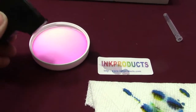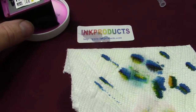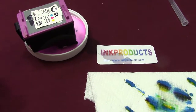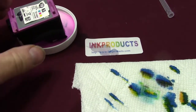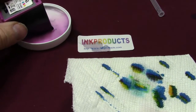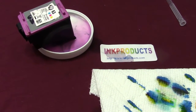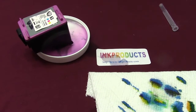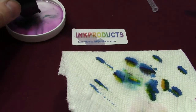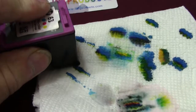In the kit you're also going to get fast-acting printhead cleaner. For older cartridges, put them in a soaking tray and let them soak for a little while. The bottom of the tray won't damage the sensitive printhead. If you warm the chemical up just a little bit — about coffee temperature — it acts even faster. This was an old cartridge that had been sitting around. You can then blot it and see if your colors are coming out — and I'm getting all my colors now.